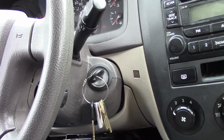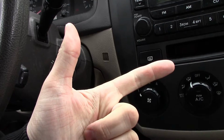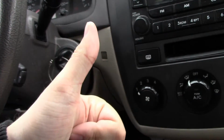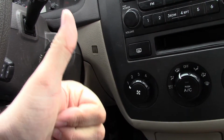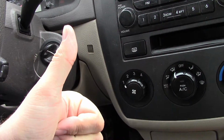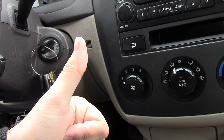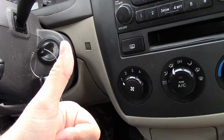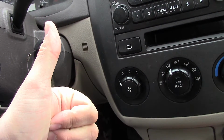Okay, so when that won't go, I'm gonna guess that it's one of two things. It's really cold outside, and so that tells me that it could be the battery. So it could be the battery is bad, and it can't handle the cold, and it needs to be replaced. Or it could be that some dome light or something got left on, and the battery voltage is low. The way to fix that is to jump the car or to charge it using a battery charger.